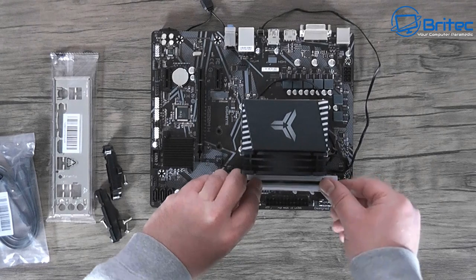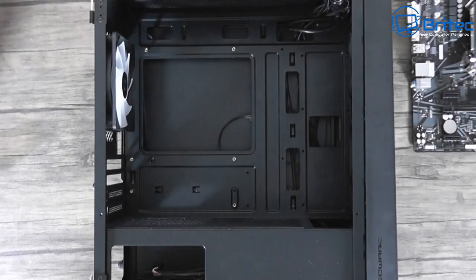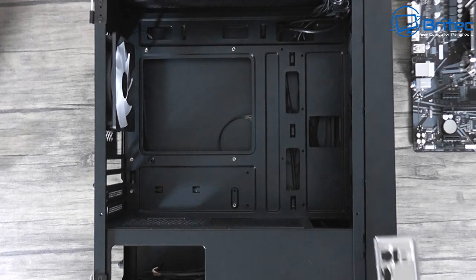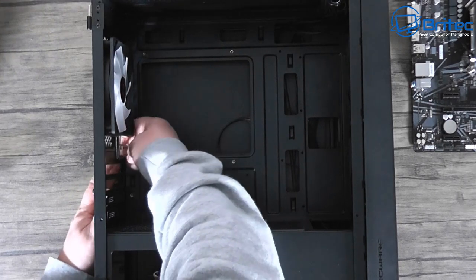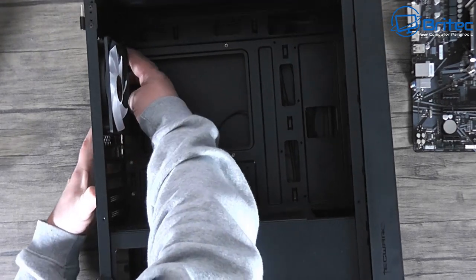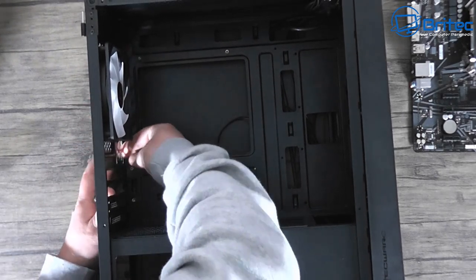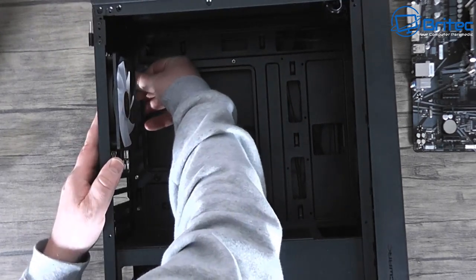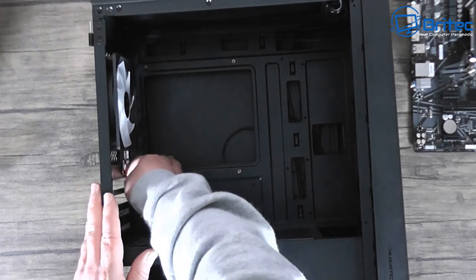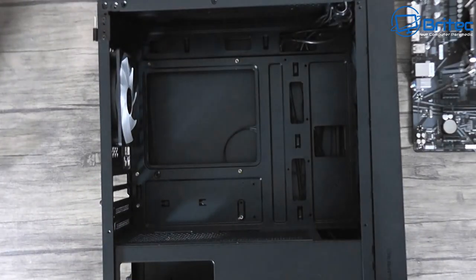This is pretty affordable RAM if you want a nice-looking RGB option. Don't be too frightened to push it down - you want to hear a clicking noise. Next step is putting in the IO shield - clip this into position, you should see a little ridge, and just pop it into that recess. If you get any difficulties, use the back end of a screwdriver to push it in. Check that it's nice and level and the grounding straps are all okay.